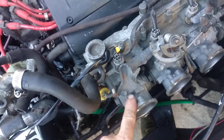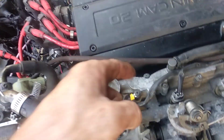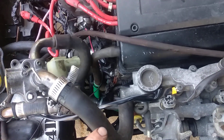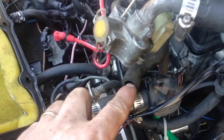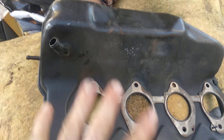In a fuel injected motor, you don't set the idle by opening the throttles and leaving them open — you get side effects from that. What you do in a fuel injected motor is bypass air past the throttle body. If we put air in this pipe here and pull it off, it'll rev real high at idle. Coming down here it gets to the IAC, which gets air from this hose that belongs on the air filter plenum.